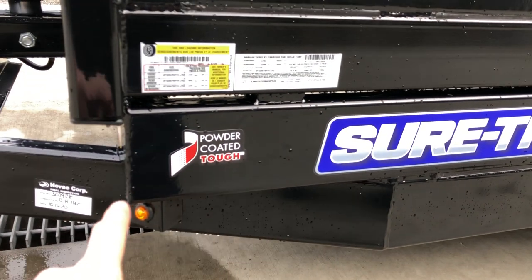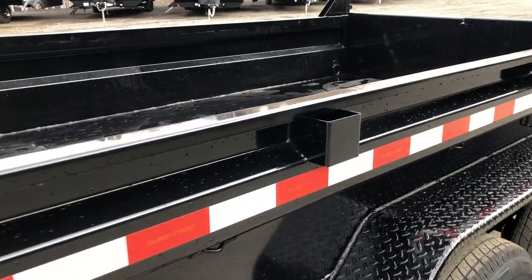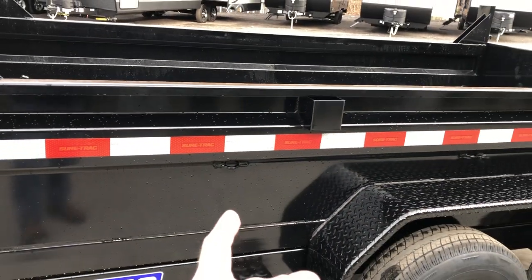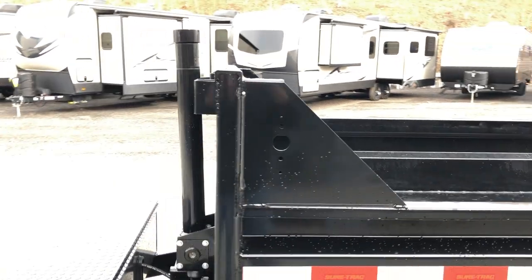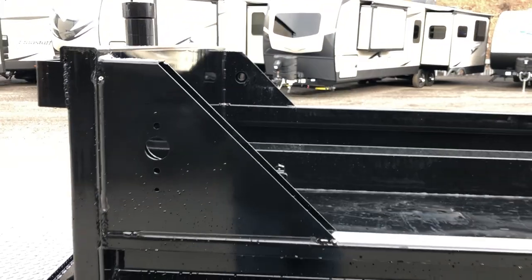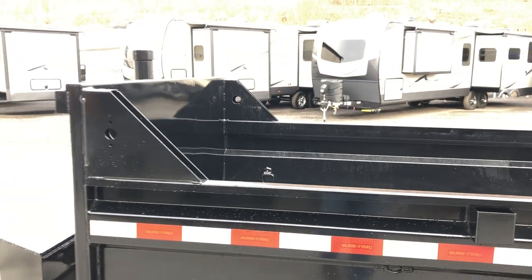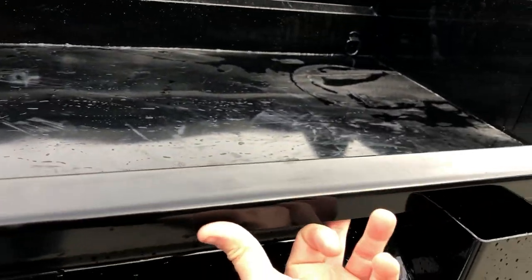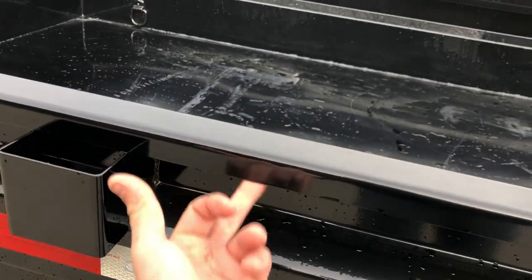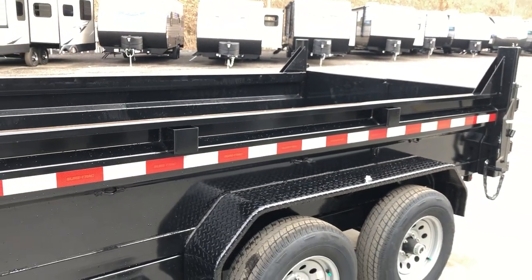This unit is powder-coated and has the newer-style bullet LED lights. Stake pockets run down the sides if you want to build sides up. It's also got hooks for a tarp kit so you can hook down with bungee cords. It's got front and rear bulkheads — these are straight because of the telescopic setup. It's already set up for the tarp kit. You can easily drop a one-foot side extension in; if you put a 2x10 or 2x12 in, you can lag into the board from the bottom at the stake pocket locations to hold it in place.